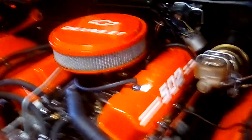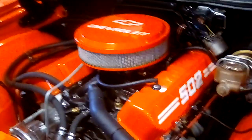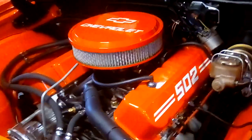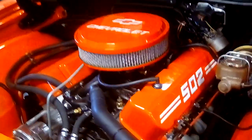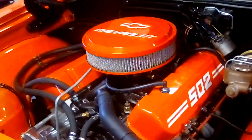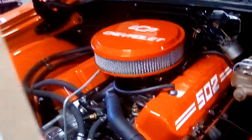You've got to run a high-volume oil pump. I got a Moroso, and a high-volume water pump. If you're going to go with a mechanical fuel pump, you've got to get a push rod that has a bronze tip so it doesn't wreck the camshaft. The camshaft is made out of a softer billet material, so you have to run a push rod with a bronze tip — I got that through Summit Racing.